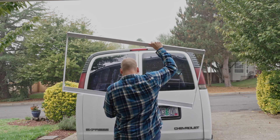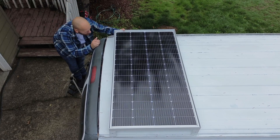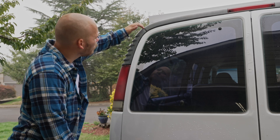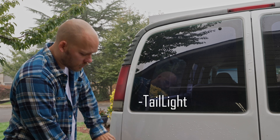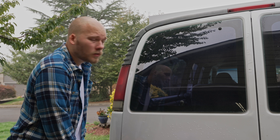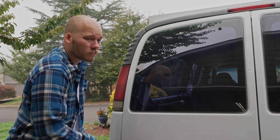With the rack built and painted, I can turn my attention to how I want to route the wires for the panel and where I'm going to mount the charge controller. My plan here is to try and get in behind this plastic cover and go down along the side of the tailgate and through a grommet down here in the corner of the van. That way I don't have to drill any holes, and hopefully it should make this installation just that much easier.